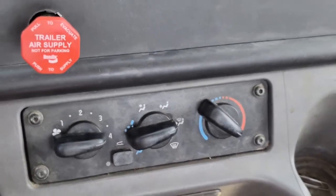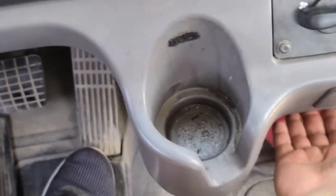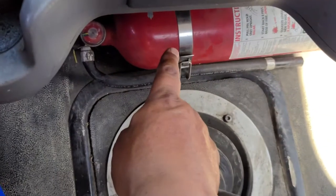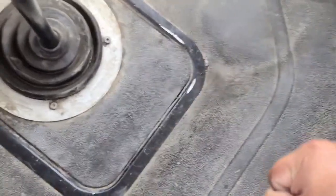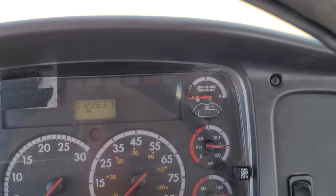After checking the fuses, I'm gonna come to the climate control — I'm gonna check my defrost and my heater. Put it here and then here, then put it on blast and wait for the air to start blowing. When you hear the air start blowing: this is my defrost, it's working properly. Right here is my heater, it's working properly. Make sure you turn it off, especially on hot days. Right here is my fire extinguisher — it's not cracked, broken, or leaking, securely mounted, no missing hardware, fully charged and properly rated for this vehicle. The pin for my fire extinguisher is in the locked position. From my fire extinguisher, I'm gonna come to the jockey box. Inside my jockey box I have three reflective triangles — they're not cracked or broken, securely mounted, no missing hardware. I want to mention that my floor has nothing obstructing my pedals when I'm driving, and in my dash there is nothing obstructing my view when I'm driving. This completes my in-cab inspection — turn off the truck. Wait for the grader — for the light check, pre-trip, air brakes, and in-cab inspection. Good luck on your test, hopefully you pass.